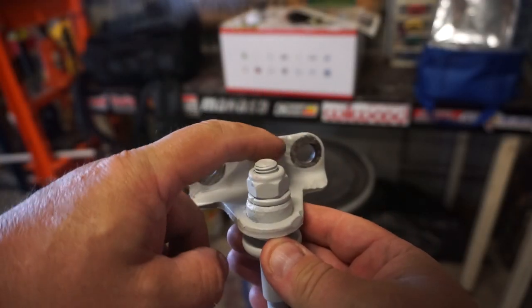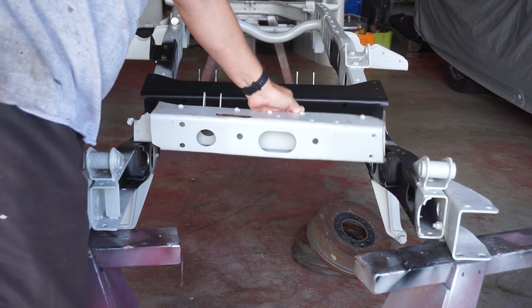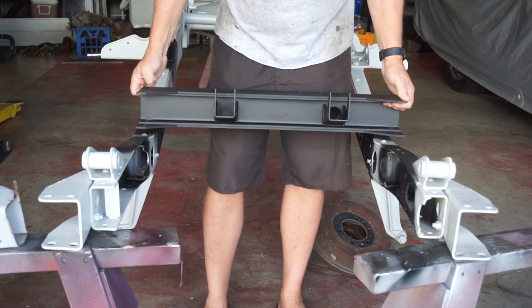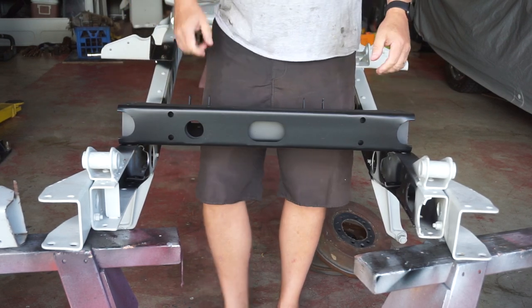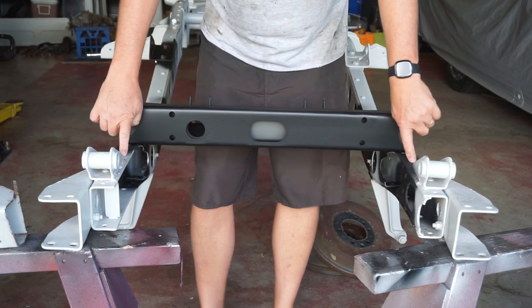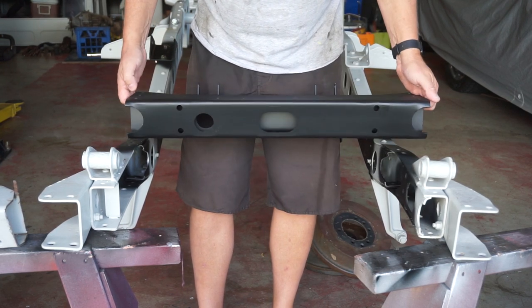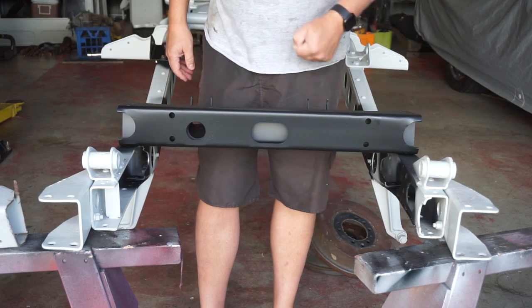That's got a few grinder marks here and here — those nuts have actually been chopped off in the past and replaced. Here's the frame cross member bit that I've chopped out; that sat in between the frame rails like that. And here is the unit from McKinnon's Cruisers, and this is one seriously heavy duty unit that now bolts in between the frame rails. You can't actually get it to fit by going in sideways, so I think what I'm going to have to do is put a couple of straps on either side of the frame rail and basically spread her legs open to be able to slide this in. I only need to go maybe 50 mil to get that to slide in.